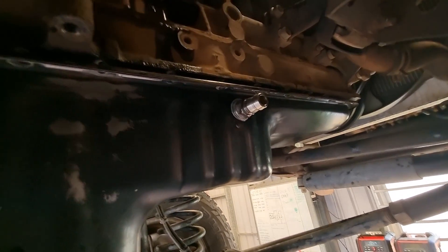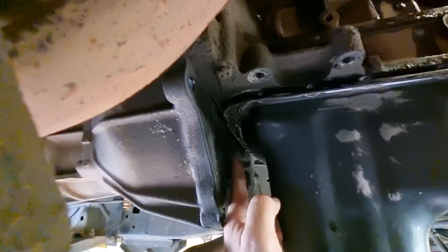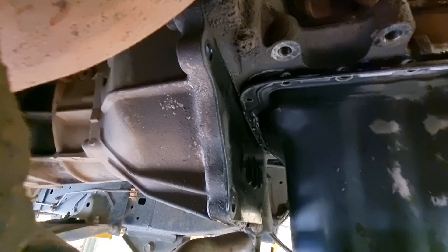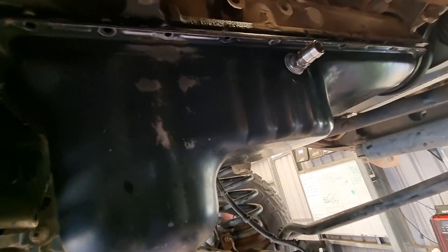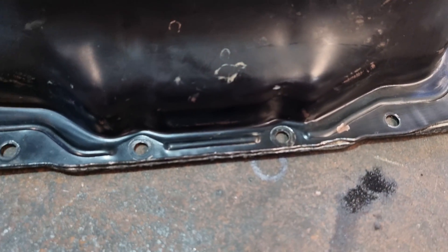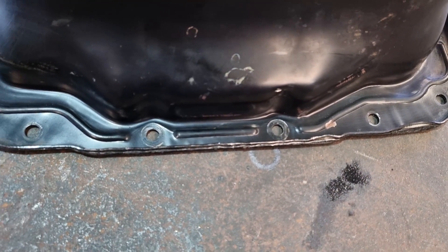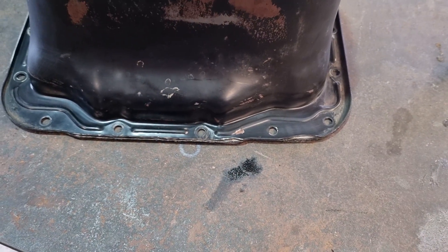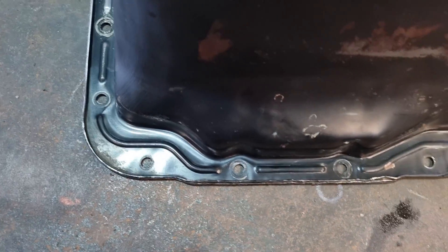I did a quick little test fit. Everything went well except this sandwich plate fouled against the back of the sump with these two locating studs. Very snug, so I had to give the sump a little bit of an adjustment with a hammer but it didn't take much and it came good. This lip here was fouling on the sandwich plate so I got my trusty hammer, gave it a little bit of a roll — being really careful not to distort the flange. Make sure that stays square or you'll have a pretty crappy seal. Maybe two or three mil and now it's snug and easy to get back in there.